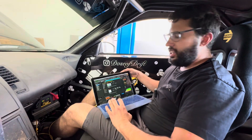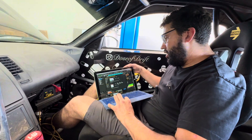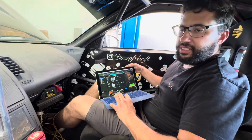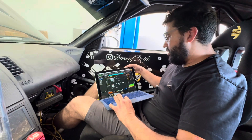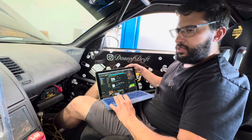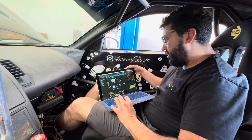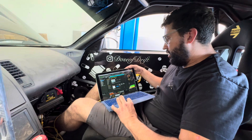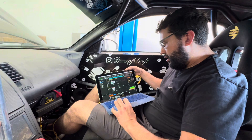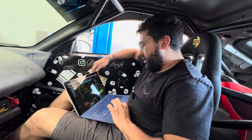Steezy got in the driver's seat — we're going to calibrate the throttle right now and see if we did that properly. Accelerator pedal is not pressed — confirmed. Calibrate. Now press the accelerator all the way to the bottom — hold it. Calibrate. And now it's calibrating the throttle body. I hear it doing things. And now it's green. Complete.